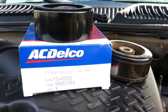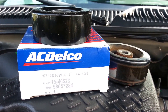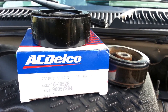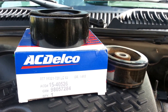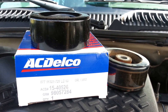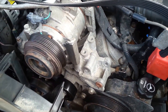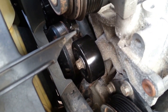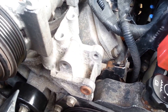When doing this and replacing the idler wheels, it's a good time to replace all of them. It's a 14mm or 9/16 head bolt. It is pretty tight, and without removing the fan assembly it's going to have to be done with a wrench. Add the new idler pulley in the bolt location that's already provided, right adjacent to the vacant alternator bracket space.